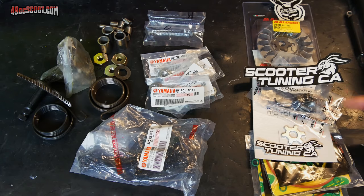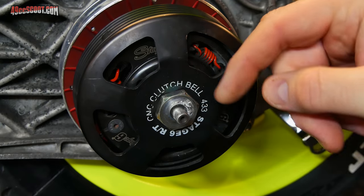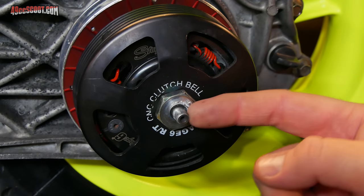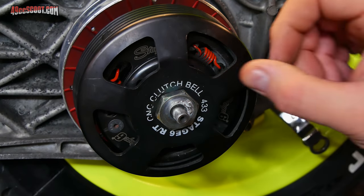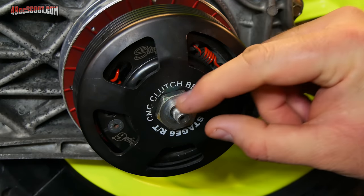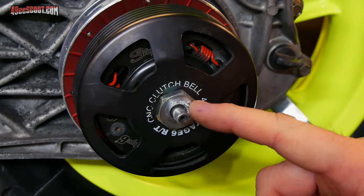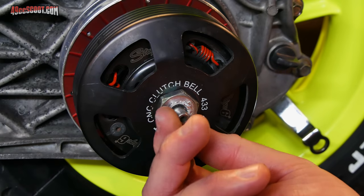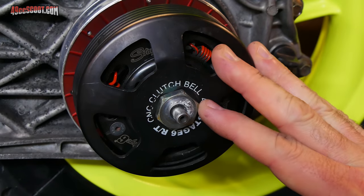can beat their service. The bushing failure left big chunks of aluminum on the clutch nut as well as on the drive shaft, so I've already chipped away everything that was near the center of these with a screwdriver or a chisel and a hammer, and I'm hoping that now I'll just be able to remove this nut, maybe do a little cleanup to the shaft to make sure it's okay, and then replace the nut, and that should fix this issue.